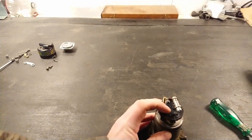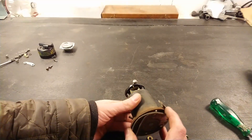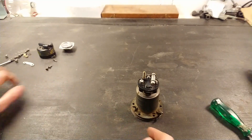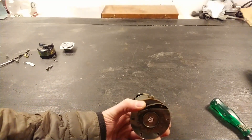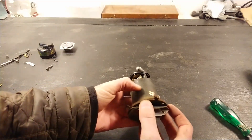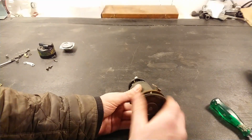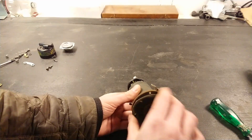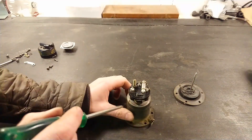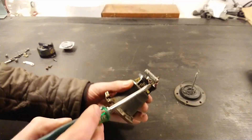In order to get the points out you need to disassemble the whole top half — that's the easiest way to clean them. Take out the diaphragm first. These little washers or the plastic ring that sits around the middle will fall out, so watch for them. That's the center shaft and housing. The diaphragm just unscrews and then there's a spring behind it.